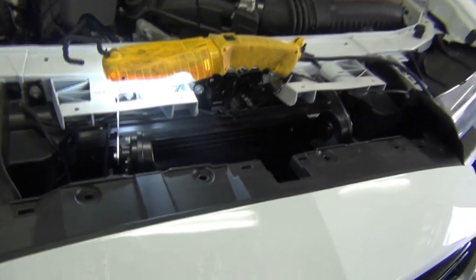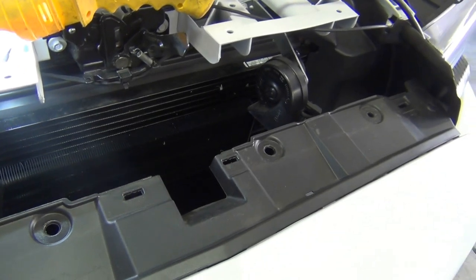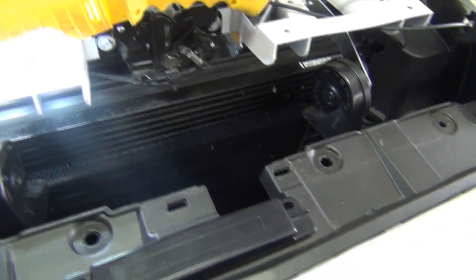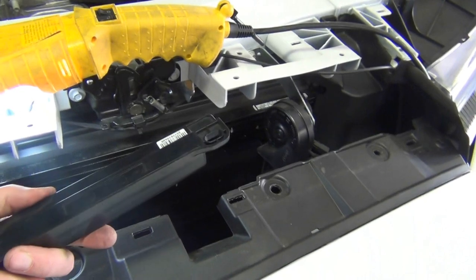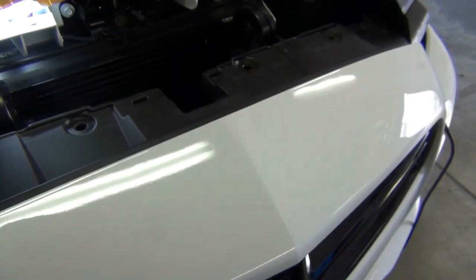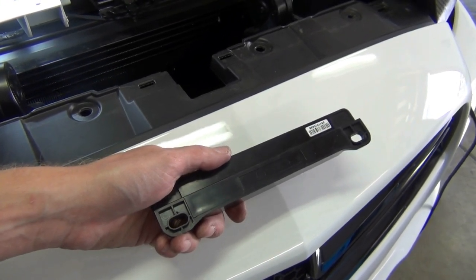You're probably going to ask why am I removing the fascia on my brand new car — a lease car, no less. Well, you guys have bridge toll transponders out there. I got this bumper-style bridge toll transponder, which I always prefer. I don't like the big square white ones we have in California sticking on your window — it looks like crap. I've always used these; I just throw it in the glove. I've had success in some of my Wranglers putting it under plastic in the front, and it always works. The only reason it won't work somewhere in the front is if there's metal above it. Here we have a plastic bumper — perfect situation. I'll tie wrap it up there under the plastic with no metal, and then it's a permanent bridge toll — don't have to pull it out every time.